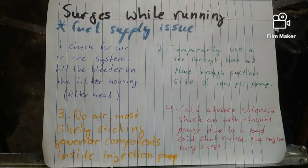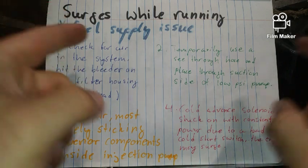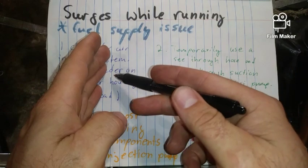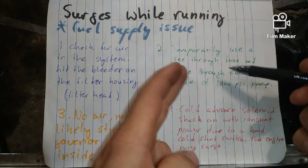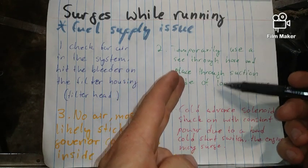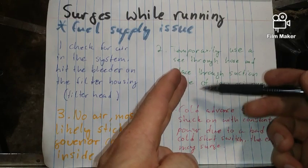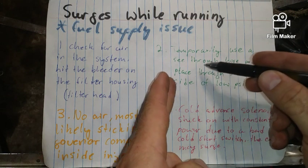Let's say that you keep having air being drawn into the system at the top of the housing, and you haven't touched anything. This issue just kind of appeared out of nowhere. Well, what you can do is find some areas in your line, starting at your fuel tank, you'll have the vacuum or the suction and the mechanical guy that pumps it up. It's a supply pump from 4 to 8 PSI. Usually it mounts on the side of the engine. For Ford it is, I don't know about Chevrolet, but it supplies it, and then that's where the little 4 to 8 PSI comes in.